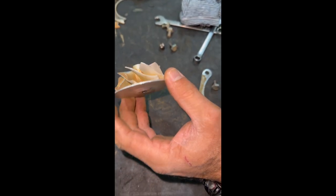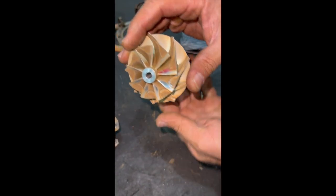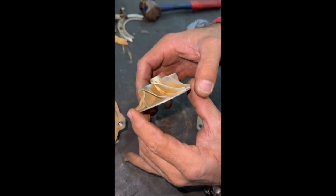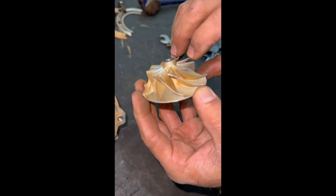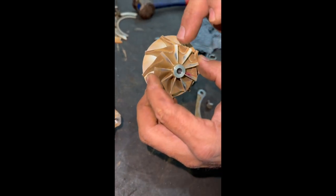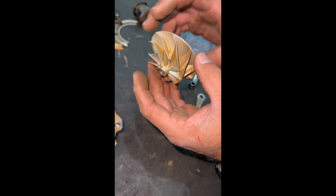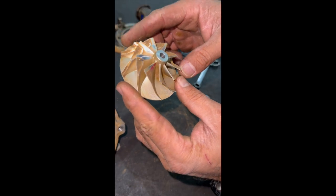Here's the compressor wheel — let's have a look. If you look at the bottom of the blade, have a look at the difference in color between the shiny top of the blade — that section there is still obviously raw aluminium — and compare it to the underside of the blade. All the blades underneath have this appearance of being sandblasted, and that's because they have been sandblasted. If you feel the leading edge of the blade, it has a slightly rough feel to it, but the material we use is really tough and designed specifically for applications where you're expecting dust exposure or ingestion of fine particles.